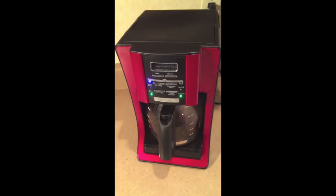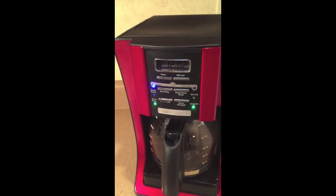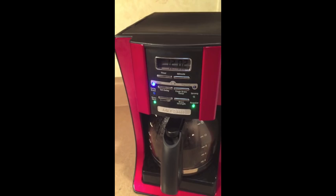As you can see, we are brewing coffee! So if you have trouble with a Mr. Coffee — or actually any coffee maker for that matter — go ahead and pull it apart. Check out that supply tube coming from the chamber down to the heating element, clean out that tube, and make sure that valve is unclogged. So there you have it.